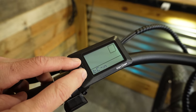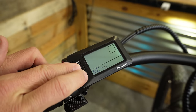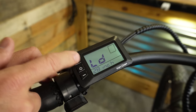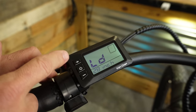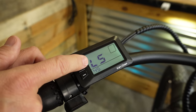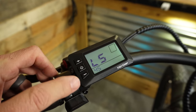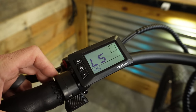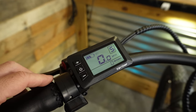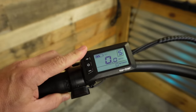To get into the menu, hold both the plus and minus buttons. That takes you into the first menu. Then to get into the super secret menu, hold down the power button and the negative button. This screen shows tire size and wheel size combined — don't change that. Hit the power button and it'll take you to L5. You can change this all the way up to 45, which will max out the throttle to match the pedal assist. To exit, hold down the power button to get back to your main screen. I'm not sure this hack works with all other Ride One Up bikes, but it definitely works on the Cafe Cruiser.